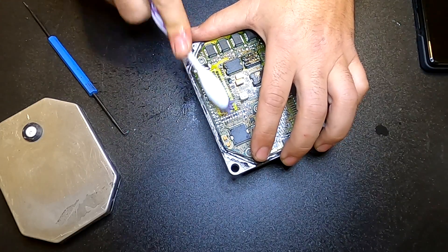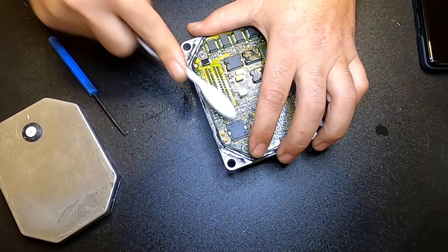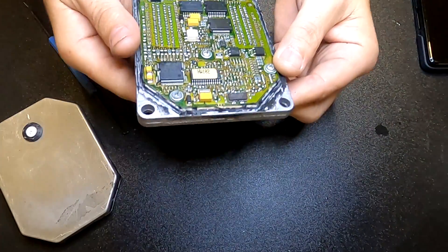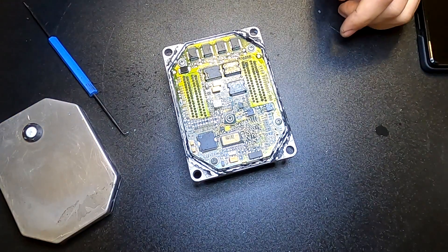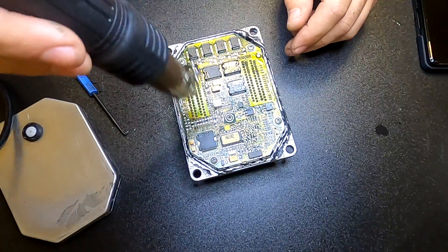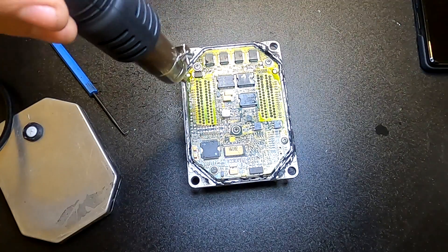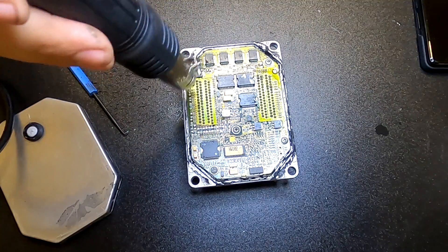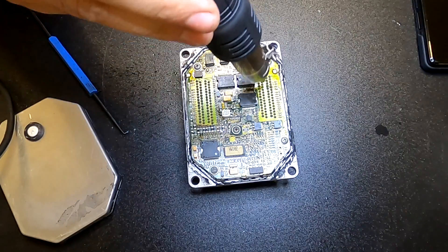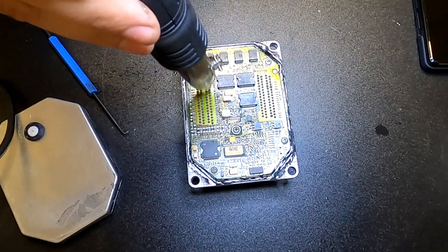All of those heating cycles cause the solder points to crack, and that's what usually happens with ECUs. First we are going to start by cleaning with some alcohol and a toothbrush, then apply some hot air to dry everything so we can see clearly. I'm going to solder every single point — even if it's not broken already, it might be on its way, so might as well do all of them.